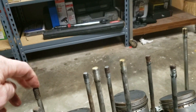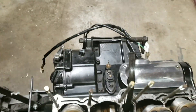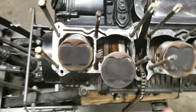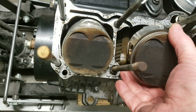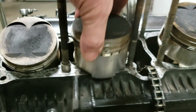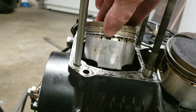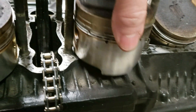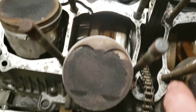The pistons don't even look roughed up or hardly used. Looking at the head bolt studs — other than a little bit of exhaust residue right here that might have been from where it was leaking — these pistons look really good. The rings look good as far as free play goes. I haven't measured the specs yet. There's some play in the wrist pin itself, but I'm going to pop the pistons off, take the wrist pins out, and clean them up. They look real good. You can look down in there and see the crankcase.